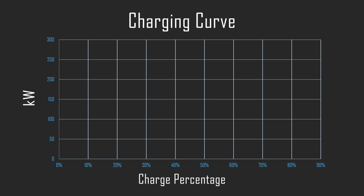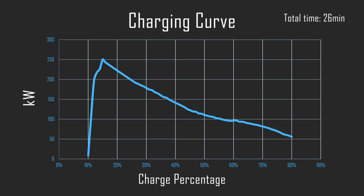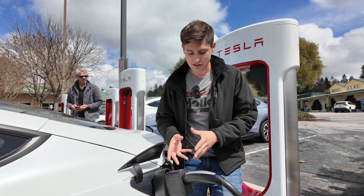After another five minutes, the Tesla reached 80% state of charge. I graphed the charging curve using Tesla Magic Dock and the EV Base CCS adapter. The test began at 10% state of charge; the curve quickly peaked at 250 kilowatts before a steady decline. At the conclusion, the car was still pulling 55 kilowatts at 80% charge. Total charge time was just 26 minutes, better than the estimated 30 — impressive given we used both Magic Dock and the EV Base adapter.